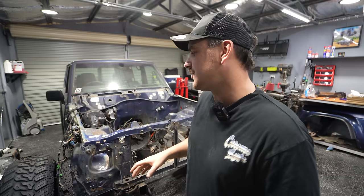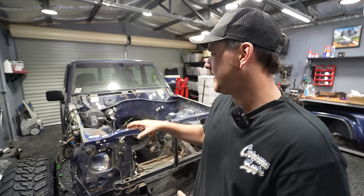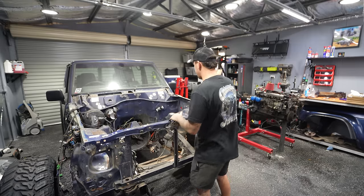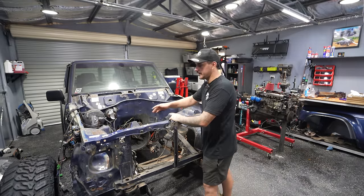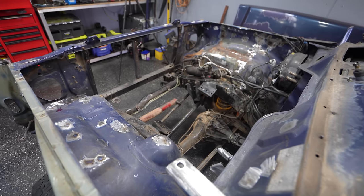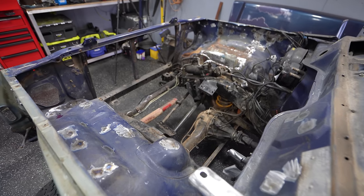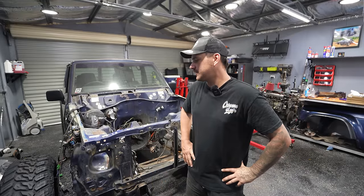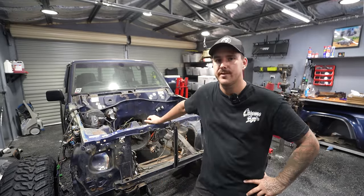So that's just about every single little hole welded up and flat back inside the engine bay. Now, it's as far as we're going to get in today's video in the bay itself. I don't have any bog, and because I want it to be really, really nice, what I want to do is smooth out all the welded and pitted sections, including where that battery tray was. It's quite rusted, so we'll smooth all that out with a bit of bog. That way, when we paint over the top, it's like a dead smooth finish, and it's going to look really, really nice.